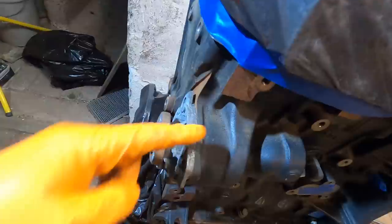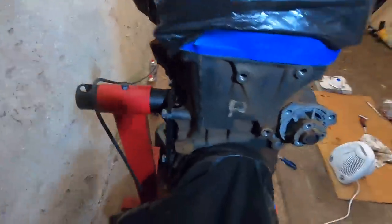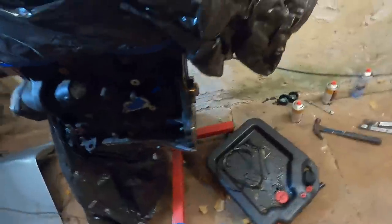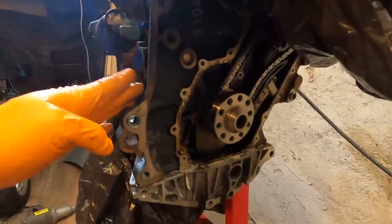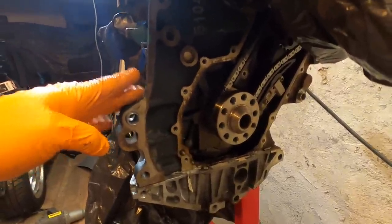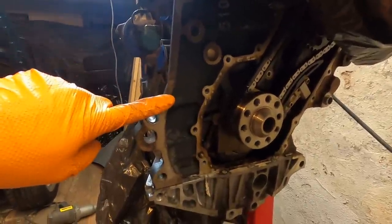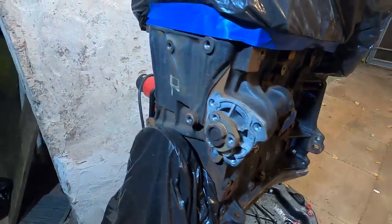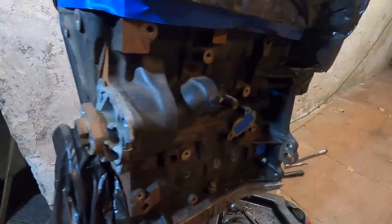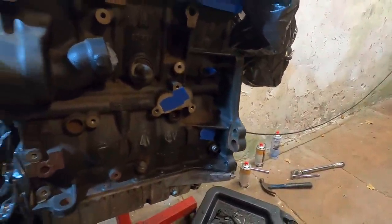I've got some plastic in here, so there's nothing there. I put the old water pump on that, so I had to block this section. We covered up the crank, covered up the top of the engine, and then on the back, we'll go through and paint this as well. But it's gonna look good. I'm excited. Then over here, you don't wanna paint anything on this. On my first VR6, I painted all these pieces, but anything that's bare metal beforehand, you wanna have bare metal after. So all this stuff, make sure it's the way you found it from before. Give you guys one final before look. Like I said, this engine block wasn't too dirty to begin with, but it's about to look way, way better.